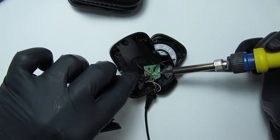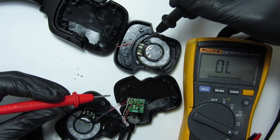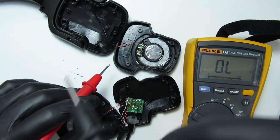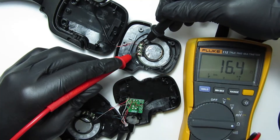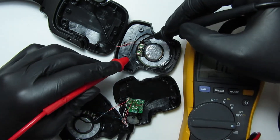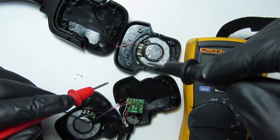For further testing, we now move toward disassembling the headset's right earpiece. The continuity test on our multimeter tells us that there is an electrical path established between designated points, which is good. Both of our earpieces are reading measurements of less than 25 ohms for their individual impedance, which is also good, since it requires little power to deliver high audio levels.